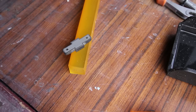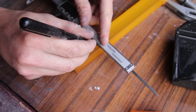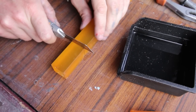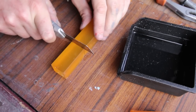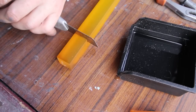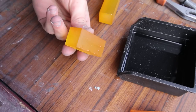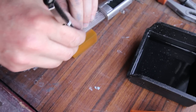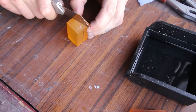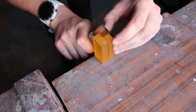With this block, I can get four pads from each 50mm section if I'm accurate. With a fresh blade, I carefully chop the block to length. I use a rocking motion to saw through initially, and only press hard towards the end. Now I need to cut this into quarters, so I mark my cuts. I cut it with a knife, but now it's harder as it's smaller to hold and the cuts are longer. It is possible if you're careful and do multiple light cuts.